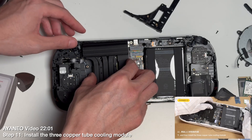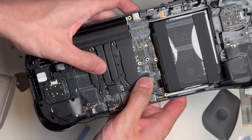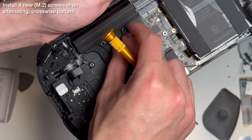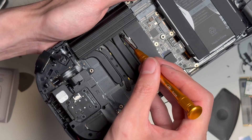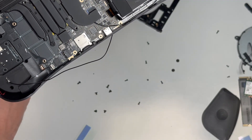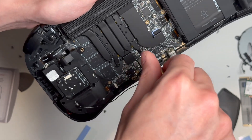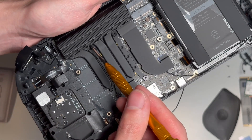We need to put thermal paste on the CPU chip before the heatsink goes on. If you're watching the original Aya video, they really lathered this stuff on there — we don't have to use quite that much, but it's important to make sure the whole chip is covered so that it can all connect with the heatsink. The idea is that when you put the heatsink on, the pressure will flatten the paste out and make a solid film between the chip and the copper. There's not really such a thing as too much paste, but you can definitely use too little — if there's an air gap, your CPU will overheat. When your paste is ready, put the new heatsink face down as squarely as possible, then press down and slide it around a little bit to make sure the thermal paste makes good contact and that your screw holes will line up. Use four new M.2 screws from the upgrade kit, and tighten them gradually in a crosswise pattern — start bottom left halfway, then top right, bottom right, top left, and repeat. By going slowly and across the CPU, you avoid putting too much uneven pressure on the thermal paste and chip. On bigger heatsinks, uneven paste or too much pressure could even crack the CPU die.